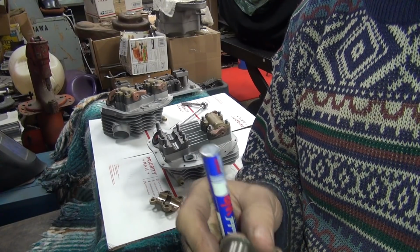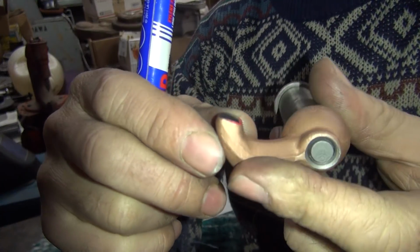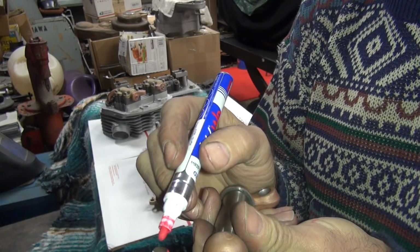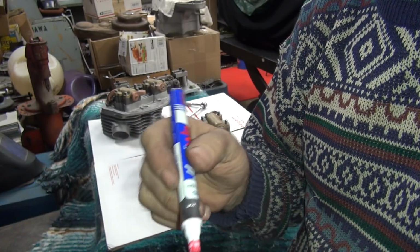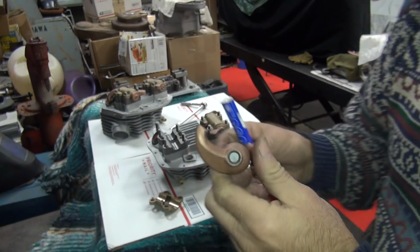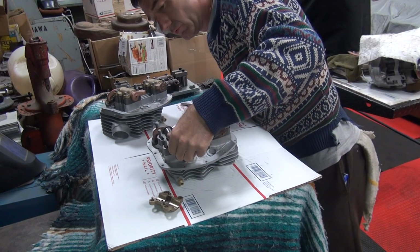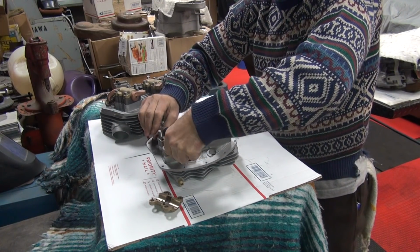Alright, we're back again. I think it's a lot flatter than I really want it to be, but it seems like that's what it's looking for. But I've redone the angle again on it. It was pretty close last time on the side-to-side angle, but see what we're going to get this time. It's getting pretty flat, so if I get too flat, it's going to start hitting on the inside edge here. I'll have to grind that back out, which I'm kind of hoping it is because it looks pretty damn flat. It's definitely right there.